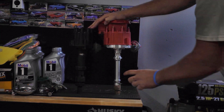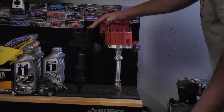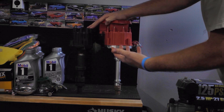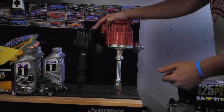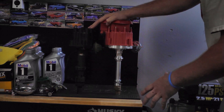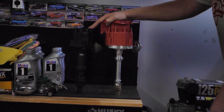If we were to take this off, the gear is completely different — that's a pretty easy swap — but there are a lot of body differences here. I don't think we're going to make this body work for an AMC. I'd like to pop the cap off; since this is a large cap model I might have to get a small cap model and make another video, but this might help people who thought they could make a large cap body fit on their AMC Delco distributor.